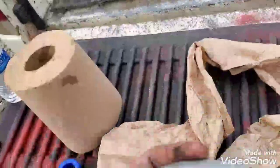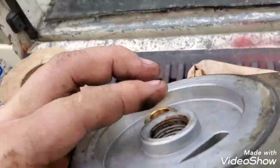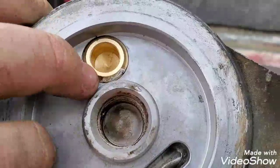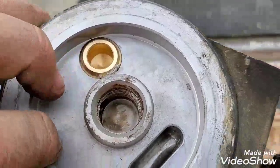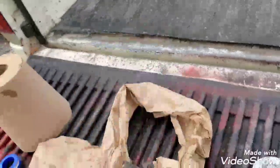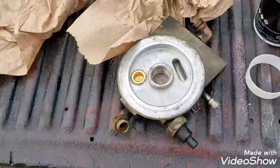Just a heads up — you want to pay attention to your depth of your plug. You don't want it to get lower than the mating surface or it could interfere with your filter fitting. Also make sure to clean all that tape out of there so it doesn't get caught up in the injector pump, and just keep tightening it up until you just can't anymore because you do not want it to leak at all. The purpose of doing this is to get rid of a fuel leak, not add to it.